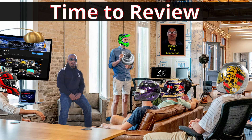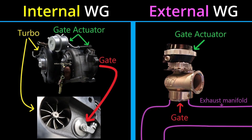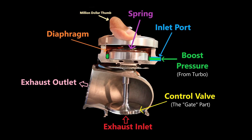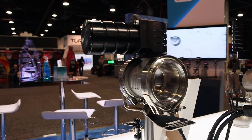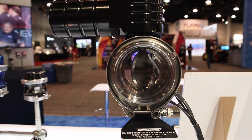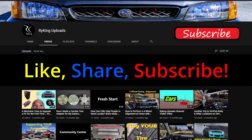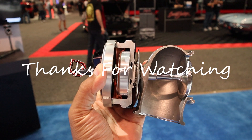We're going to review what was said about wastegates, but first, thank you to Richard for taking the time to explain how wastegates work. Wastegates control the flow of exhaust going into the turbo, which directly affects boost potential. They can be internal or external to the turbo. Size does matter. Most are controlled pneumatically, but the latest use electronic controls. With the new TurboSmart Straightgate, you can have complete control over how your boost kicks in — which means you could have a legitimate turbo button on the dash. Remember to like, share, and subscribe to the Rocking Uploads channel, where never stop learning is the goal and teamwork is encouraged.